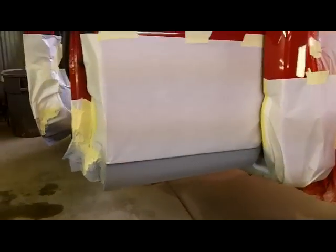I've done it that way too, but I've actually run into problems in the past with that, where it rings the repair, especially when you got a spot like in the middle of a panel. These, I'm priming such a large continuous area, my step back in the primer was actually back into the work instead of going out away from the work.